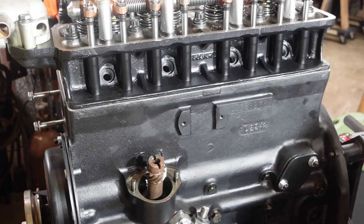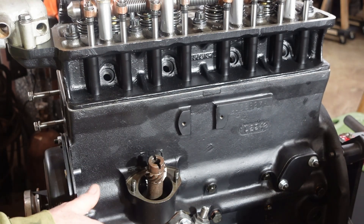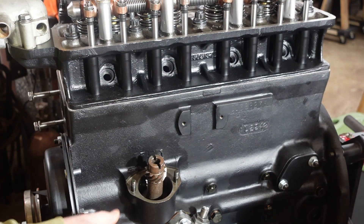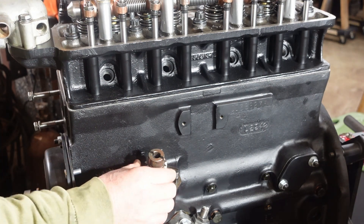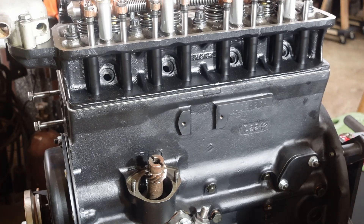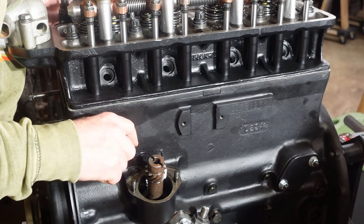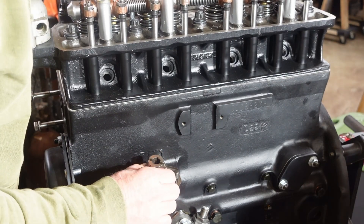We're as close as you can get it. I'm not worried about the oil pump yet — we'll take care of that in a second. That doesn't have anything to do with timing. Now I'm just trying to get that slot to point to the push rod tube. Let's play with it a little bit more here and see if I can get it. That looks like that's it right about there. I'm just eyeballing it — it doesn't have to be exact.